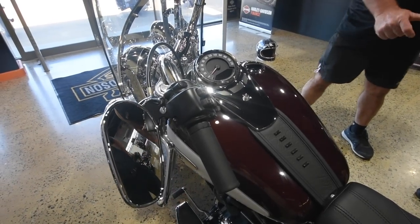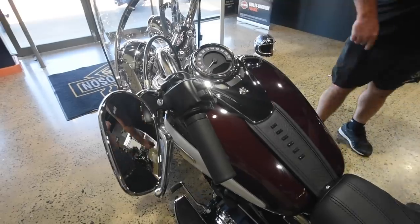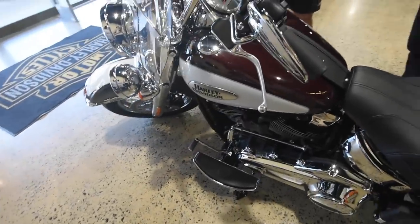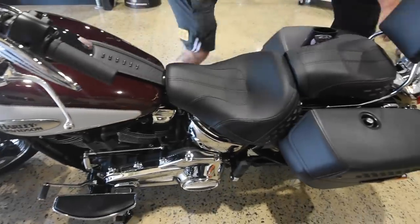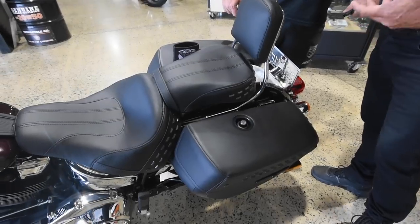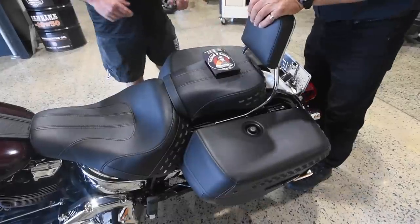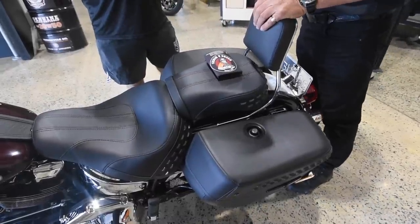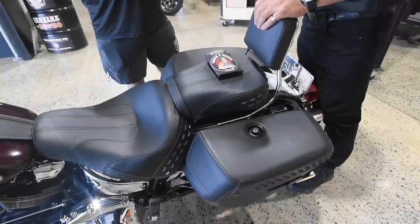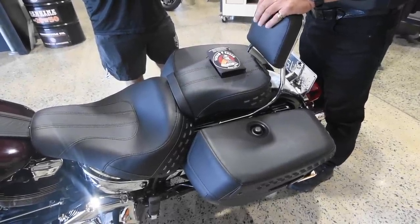Where's the shock adjustment? It's under your seat. Yeah, you'll have a seat clamp lever. Just pop your seat off - same as the Fat Boy, same as your saddlebags. What's it set at now? It'll be at an average, so it'll probably be quite light, good for one person. If you're going to go two-up on rougher roads, I'd be looking to adjust it.